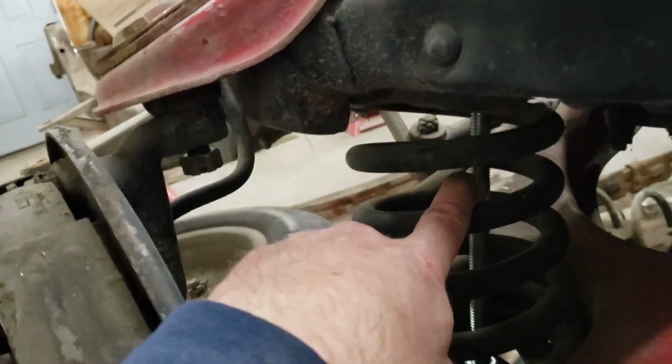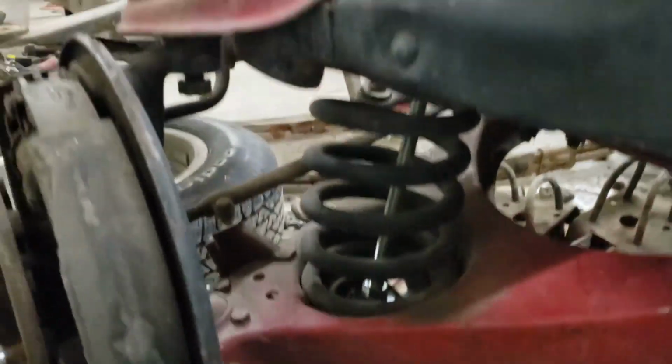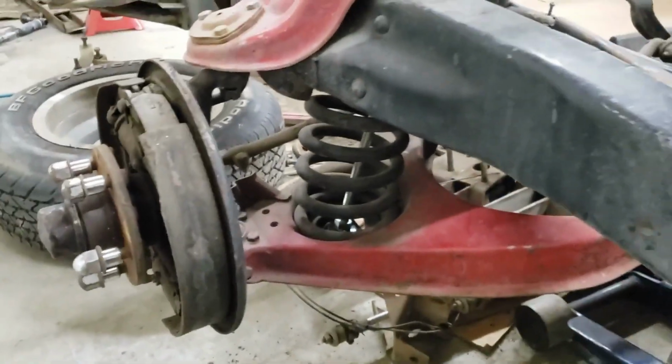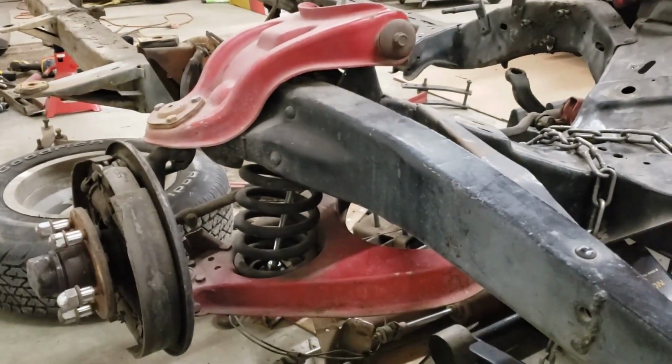And then once that falls out of there, the spring should remain compressed, or the all thread here should take up the spring so it doesn't fly out of there. And then I'll take the nuts off these bolts, and this whole A-arm is not going to open up; we have to drop it straight down by loosening the tension on the homemade spring compressor. So that's what I'm getting ready to do. I'm kind of jammed in the corner here. I don't have a lot of room. I would set up a little tripod and try to film it, but I'm just going to do it, and then I'll bring you back and show you how it worked out if I survived the whole ordeal. Let's hope.